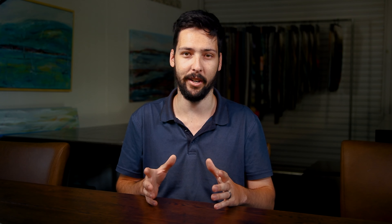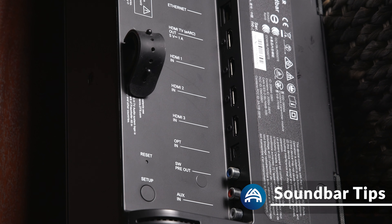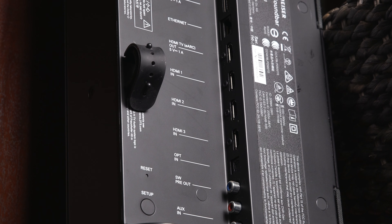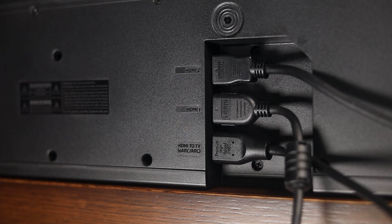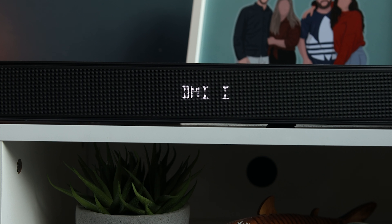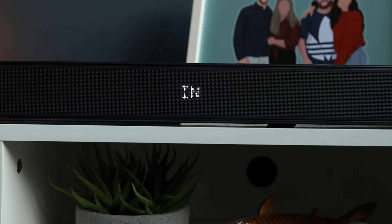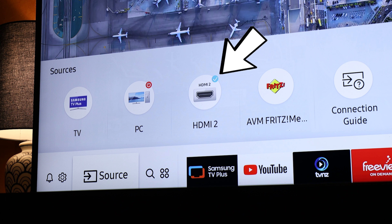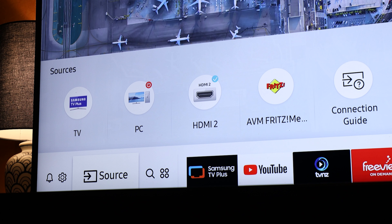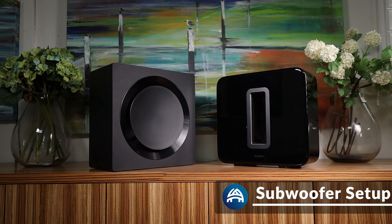Probably using AirPlay is a better option if your system supports it. Your soundbar might have multiple HDMI ports which gives you extra ways of plugging in devices. If you've run out of ports on your TV then connect any extra ones to the soundbar's HDMI in and then change the soundbar's input to that port. Also change your TV's input over to the one your soundbar is connected to and it will display the extra device on your TV screen.